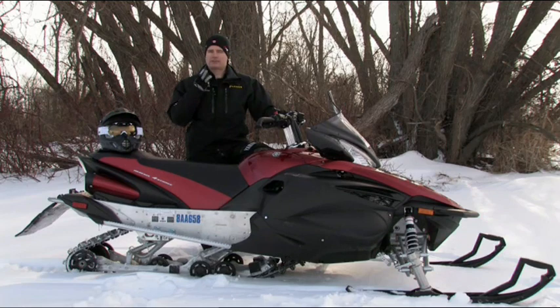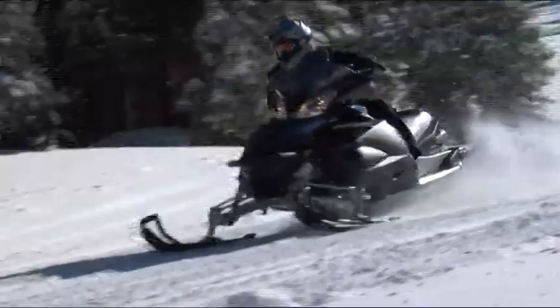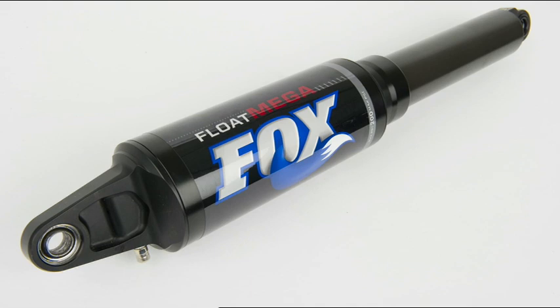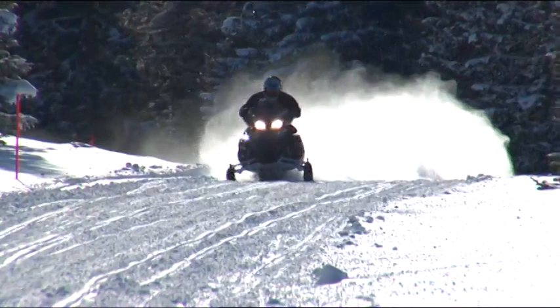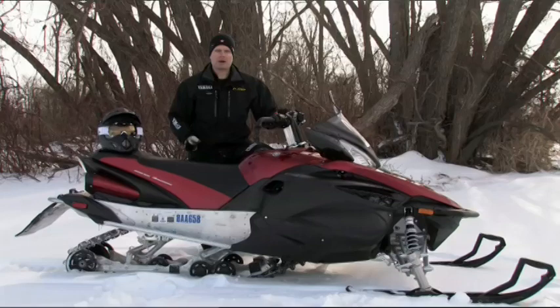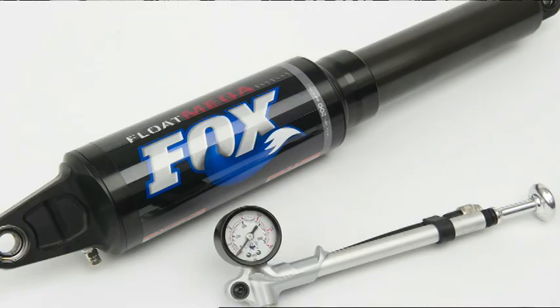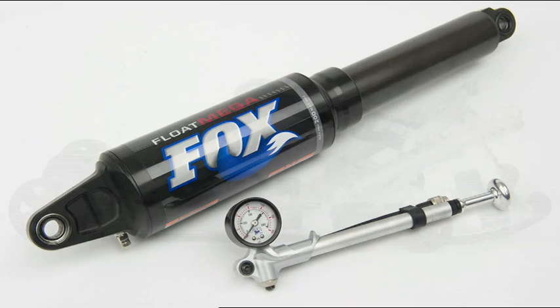Now you might be asking yourself, is this the only variation? Well no — in fact there are three variations. This being the base model with the standard monoshock and standard front shocks. There is also a Special Edition or SE variation, and that one has a complete Fox Float Air package. It has two Float Twos up front with the negative air spring, and an all-new monoshock Mega Float in the rear. We got together with Fox and were determined to co-develop a Fox Float Air shock for the monoshock. We know that floats provide incredible weight savings, and they also provide great anti-bottoming because the spring rate ramps up as you move through the stroke, plus a really plush ride comfort. Adding those three floats and taking off all the coil springs can drop 10 pounds just from losing the coil springs. And one of the great things about the Fox Float variation is you can adjust the air pressure in each shock, which effectively changes the spring rate — that air spring has great anti-bottoming.